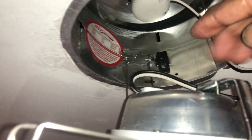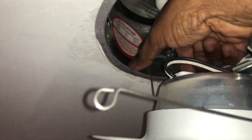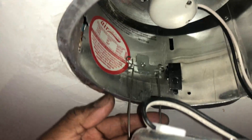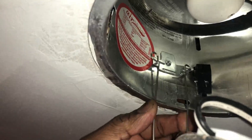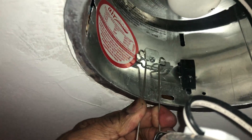This is the spring-loaded lever which you have to remove from each side. As you can see, it is in the installed position. What you have to do is squeeze these two lever bars, and then the light will come out. I'm squeezing this one, and as soon as I squeeze, they come out, and you gently take out the light.